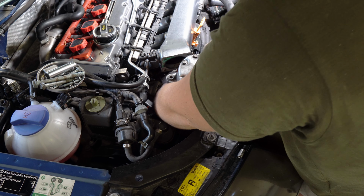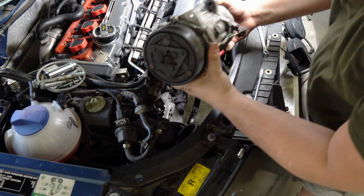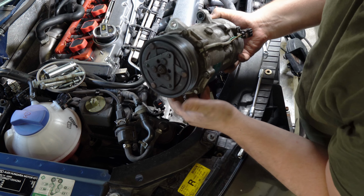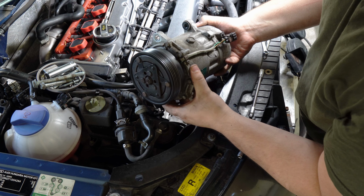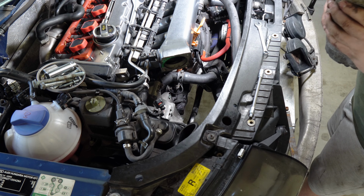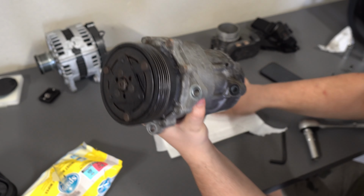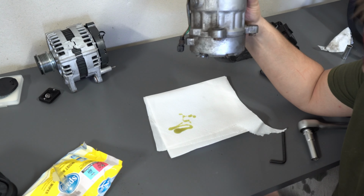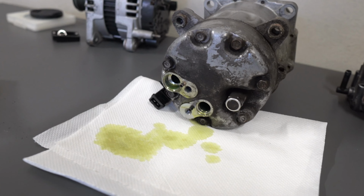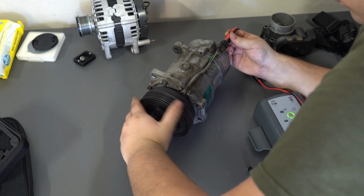Before we move on to the fans, I just wanted to quickly take a look at the compressor itself. I know someone will complain because I could have checked the clutch's operation without removing the compressor, but don't forget that these components are over 20 years old and you have to expect everything here, especially damage to the compressor shell, which may not be visible at first glance under the hood. The compressor seemed perfect with no leaks and even a little bit of nice oil dripping from inside, but the sound it made while turning the belt wheel bothered me.